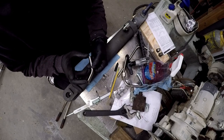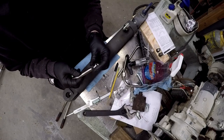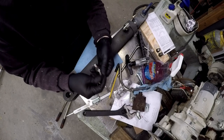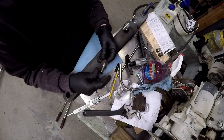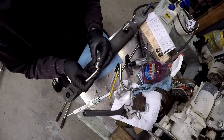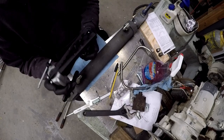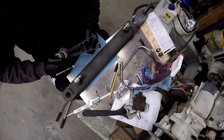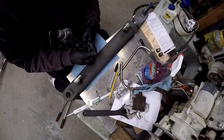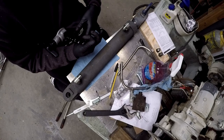We measured the length, replicated it on that side, cut the end off, and deburred it. The length should be good. Make sure we put our tube nuts on in the appropriate direction, put the ferrule on — again in the appropriate direction — double check everything. Looks good. Set up to flare — just going to make it up just a little bit proud again.